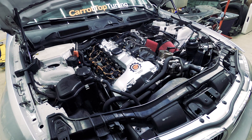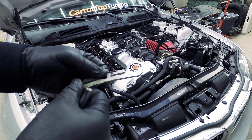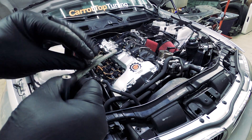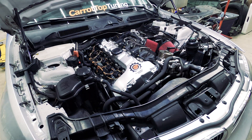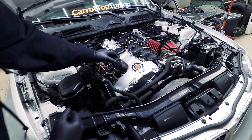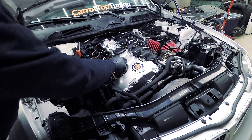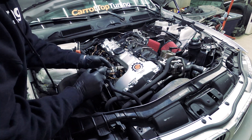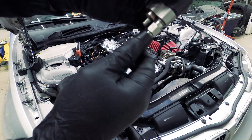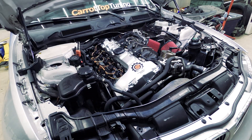Install these back — as you can see there's a slight bend to it, so the bolt will go on top like this. Now we're going to use this pull-out tool that we got from Amazon — I think they're about 50 bucks, I'll put a link in the description. You basically just yank it and it comes out; this threaded part goes onto the injector. There's one out.